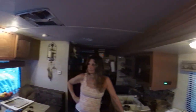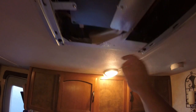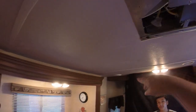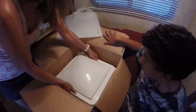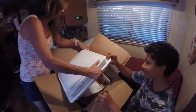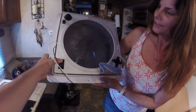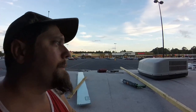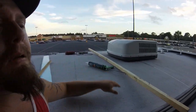Now that I've got the cover off, I can feel that the vent goes around this way on that side and this one comes around on that side and goes up this way. So there should be a blank spot right here, except maybe for this yellow cable. Here's the fan we're going to put in — it's Fantastic and it's a fan, so it's a Fantastic Fan. It's got forward and reverse and variable speed. Since I have to have the AC off while doing this, I'm starting at the perfect time — it's a cool afternoon.